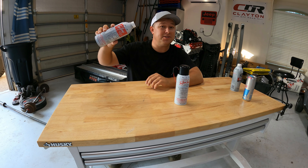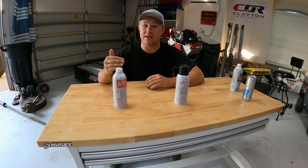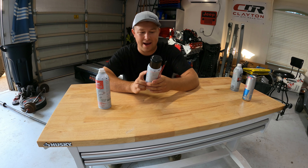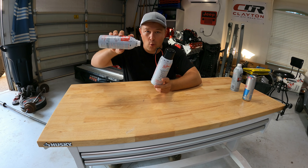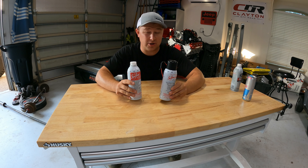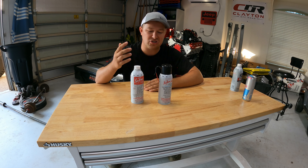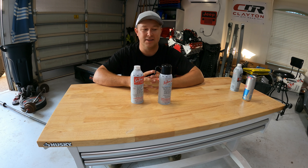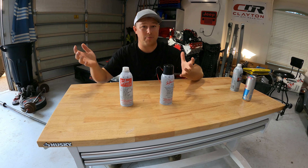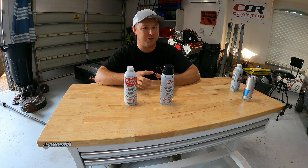The second method is to pour this into our intake system — that's what we're going to show you in this video, and that's probably what you've seen before where your Jeep is just smoking everywhere. It's definitely the most direct method of cleaning your engine. We also have an aerosol can — you just hook it into your throttle body and spray it instead of pouring it. Does this stuff work? Yes, I've used it a lot. There are times you don't want to use this — if you have 150,000 to 160,000-plus miles on your Jeep, there's probably a lot of gunk built up. If you pour this in and it loosens all that stuff, it's going to shoot out of the exhaust and possibly clog your catalytic converters. So at some point it might do more harm than good.